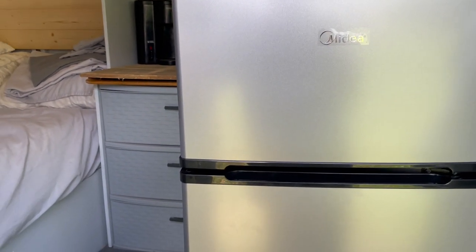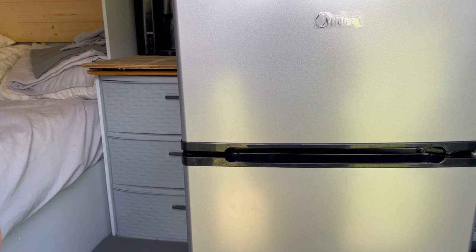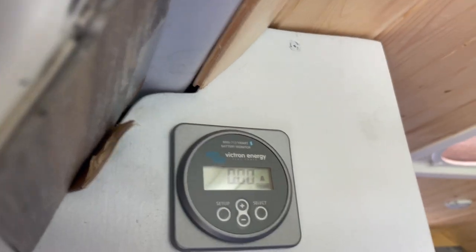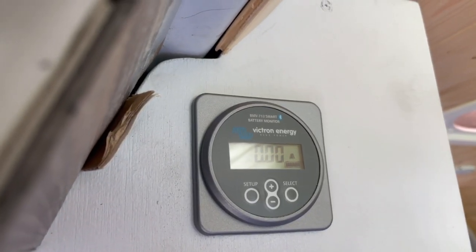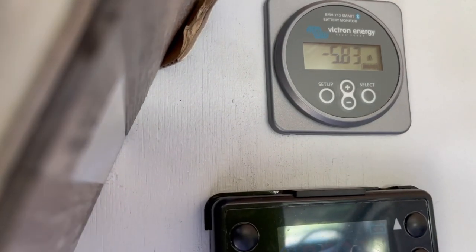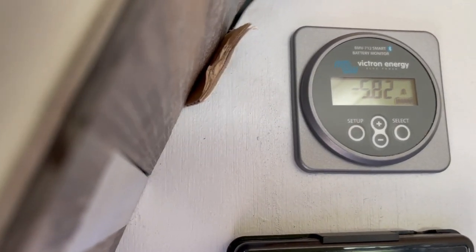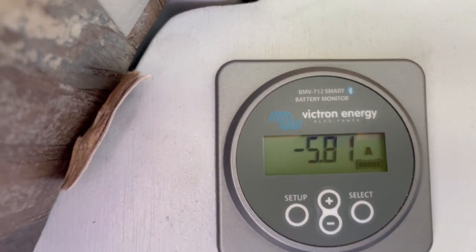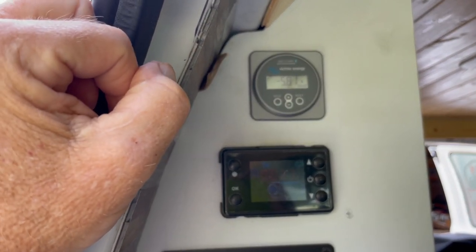On this experiment we're going to see how well the system does — we'll let it run until sometime tomorrow. After 15 minutes, here we are at the amp meter. I turned off the solar array to isolate the battery draw. The refrigerator is drawing 5.81 amps coming strictly off the battery — that's with the compressor running.